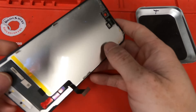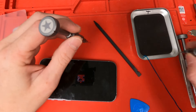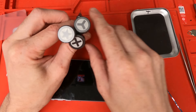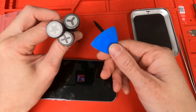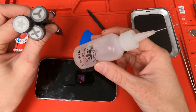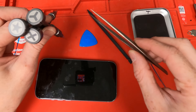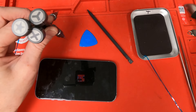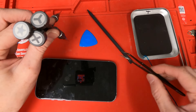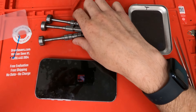Please like and subscribe and leave a comment below if you have any feedback. The screen also comes with pre-cut adhesive. For tools, we've got a star bit, PH000 screwdriver, Y000 screwdriver, a plastic guitar pick, plastic spudger, alcohol mixed with a little bit of acetone, pointed tweezers, a metal pry tool, some bent tweezers — though the tips are bent up, which is unfortunate — and a screw tray so we don't lose track of where our screws go.